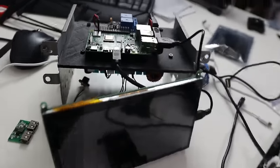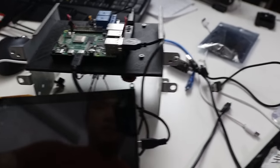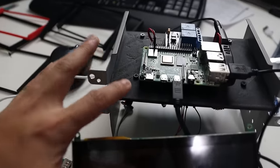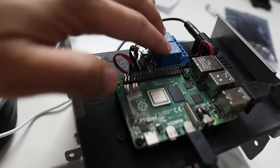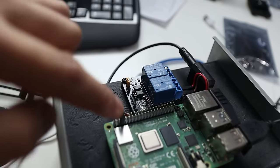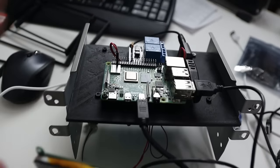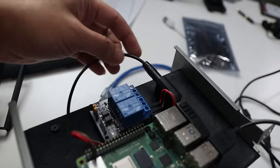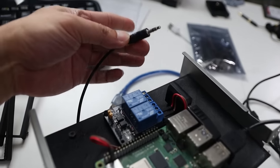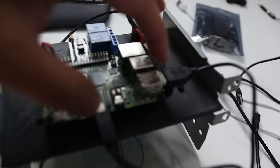So this is where I have it so far — still printed in PLA as a sample. The Raspberry Pi goes on top, then you have the two relay boards. One relay controls the on/off for the Raspberry Pi. The second relay I'm going to program for illumination — when I turn on my headlights, it will dim the screen. Then I have the USB sound card and a custom-made wire, which is a standard 3.5mm jack that plugs directly into the amp underneath. I also have the Bluetooth module, and this powers on the screen when the Raspberry Pi comes on.